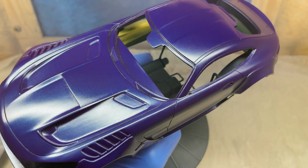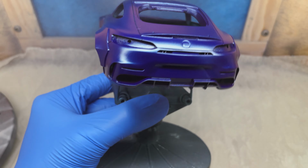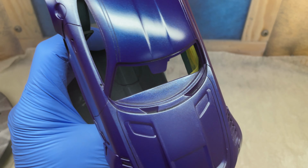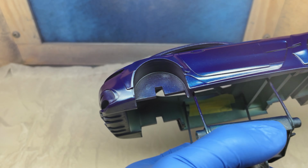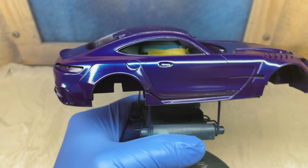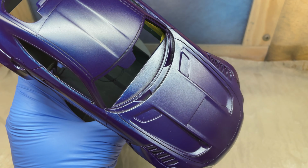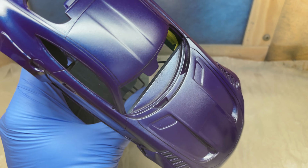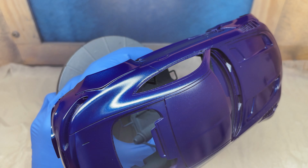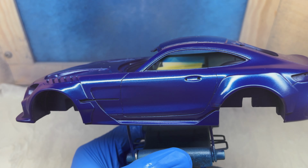You should not overspray, because then it's just collecting the dust. Between the layers, you should wait 10 minutes at room temperature before you spray a new layer on top. You can see now this flip-flop color started reflecting, so the blue and purple are showing up at the same time. This two component automotive lacquer will give a solid coat. At the end, after the coating, I will maybe spray something for the roof or the hood.